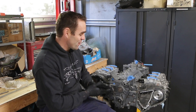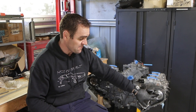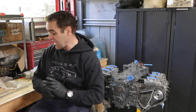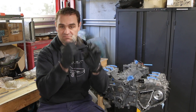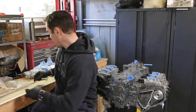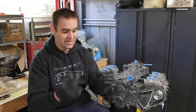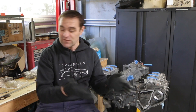Those of you who have been following this project will have seen last time I got to a stopping point where I couldn't move any further, because I realized that my new cams are actually the more modern style as opposed to the early style. To lock down the early style ones, you have a spring washer and large nut that goes on the end, and there's no thread on these new cams for that. These ones I had to send away to Porsche and get genuine new ones — they have a big thick heavy washer and bolt that go in the end of the cam. So I've got that now to fix it up.